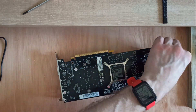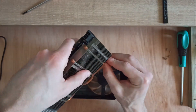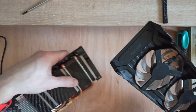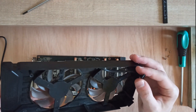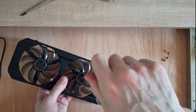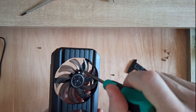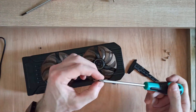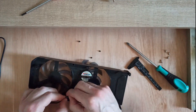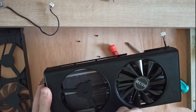Here's a random graphics card I have lying about — I'll see if I can reuse any old fan from it. Without removing the heatsink, I can remove the shroud with just four screws. The distance between screw holes is a fit, but I can't get the other fan out — its screws are stripped. Without the bare wiring I've nowhere to plug the donor fan, but it is a total, if suboptimal, fit.